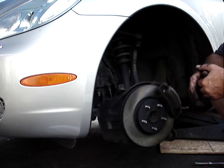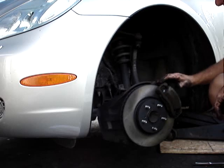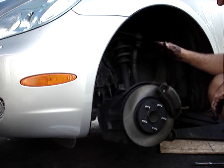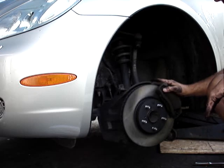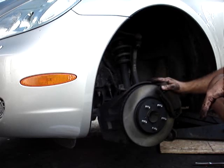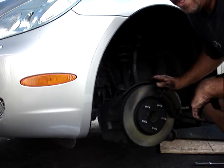Do that on the other side in reverse order. You'll be done with the whole brake job in an hour and it will be done right. Just make sure you clean up those slides where the pads go into those caliper holders — that's the most important part of this whole brake job. When you get in, the calipers have been compressed, so make sure you press two or three times on the brake pedal — it will go down towards the floor until that piston is pushed back out touching the rotor. Make sure before you back it out of the driveway, press that brake pedal two or three times to firm it up. Put the wheel on, torque it down, and good to go. Thanks for watching.